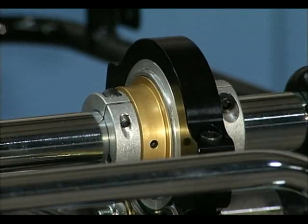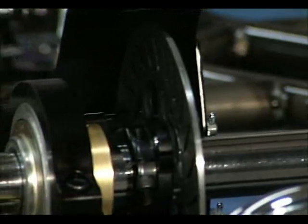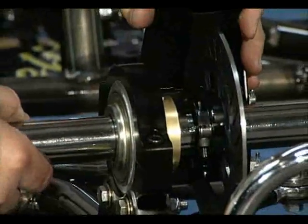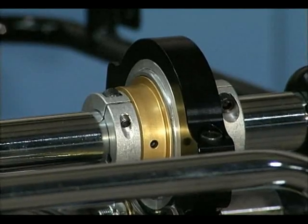You're probably asking why not pin both the right and the left. The answer's simple: if you pin the right side, it doesn't allow you to properly align the axle. So I use two axle collars on the right side — that way I can adjust for any change in frame width or anything that may happen to the cart. I pin the left, then put two axle collars securely against the bearings on each side, sandwiching the bearing with the two collars, tightening them down so there's no play in the axle, but making sure the axle still rolls freely. If your axle feels tight, check that one of your axle collars hasn't slipped slightly, putting your cart in a bind — just readjust, make sure it's tight but spins freely, and you're good to go.